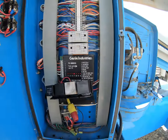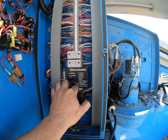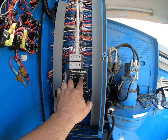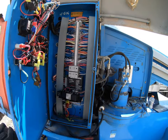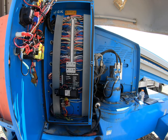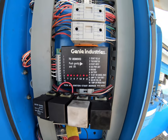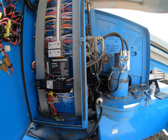In order for these things to start, we want number nine — ignition or fuel — to come on. We also want our start input, because it's cranking. The start relay should be coming on, and we also need tachometer, so we need number two to come on, because on this waste spark ignition it relies heavily on the crank position sensor and has to see a certain speed to get spark. Those are the inputs we have to have. If I crank it, we're getting number two, nine — ignition or fuel — start relay, start input. We're getting all those signals there.